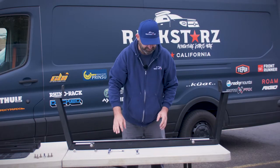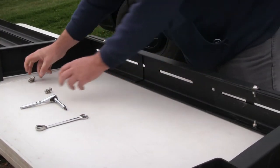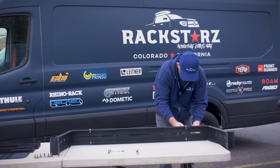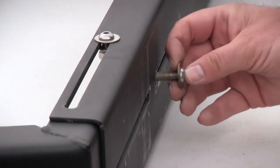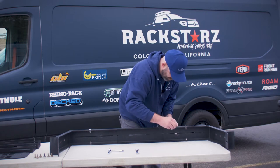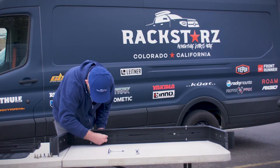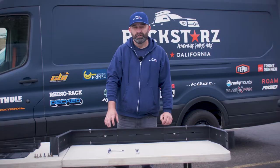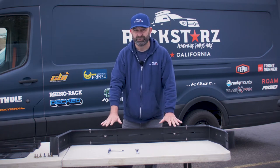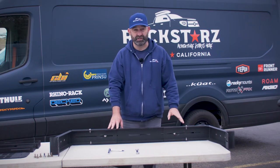Once you've got those four in, you can put it on its side and insert these through the top, the same way you did the other ones. Lock washer on the other side, nut, and then hand tight. The next two steps are going to be exactly the same — we're going to want three of these complete. Just remember to not tighten them completely; you want them hand tightened because we have to adjust them on the vehicle.